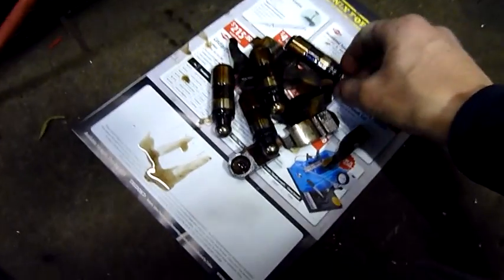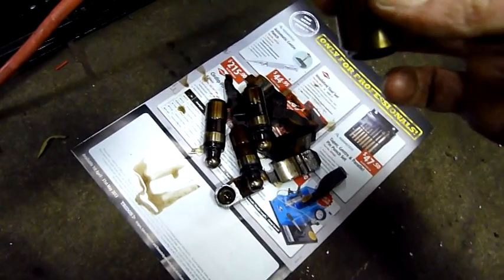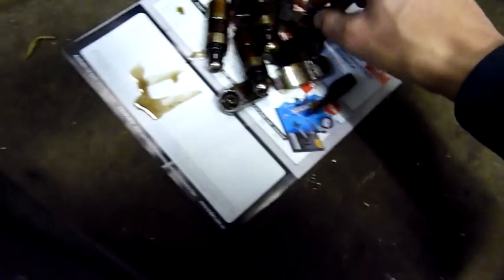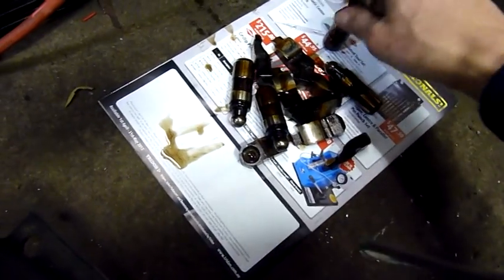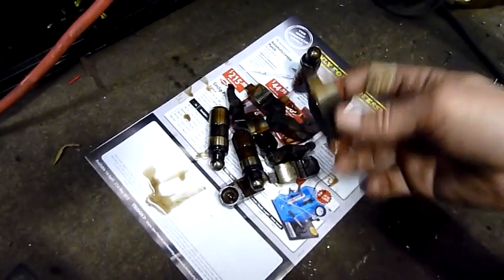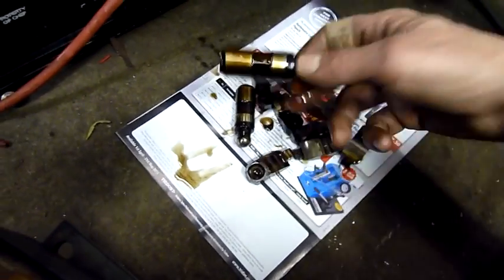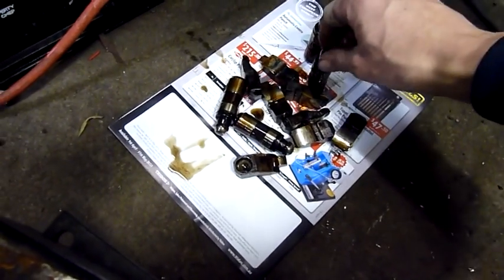I did try to dismantle one of these but it's pretty hard. There is a little pin that pops out from the end of it. There's a little oil hole in the side there. They look like a lifter - get rid of the ball on top and it just looks like a hydraulic lifter from an old Holden or Ford pushrod engine, but these just sit underneath the ends of these little cam followers and take up the slack when they're under pressure - or at least they're supposed to when they're not glazed up and stuck in the bores.